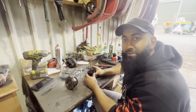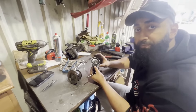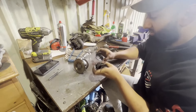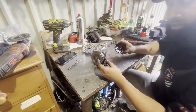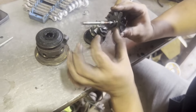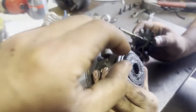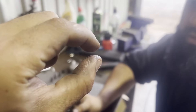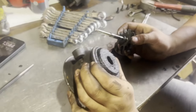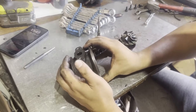The oil we're seeing here - is that a possible cause of failure? Yes. It's been burning oil. So are we looking for a leak somewhere? If you've got oil on the heat shield then you're going to have a leak somewhere. That will be worn either on the bore - the bore in this housing is worn so when the ring compresses it leaves a gap instead of sealing. The thrust bearing can cause that as well, or the piston ring on the turbine side wearing out.